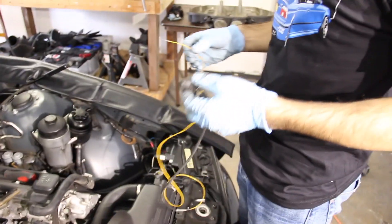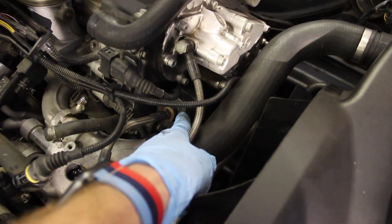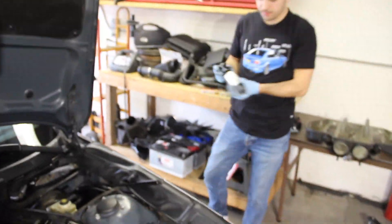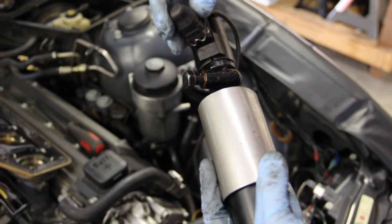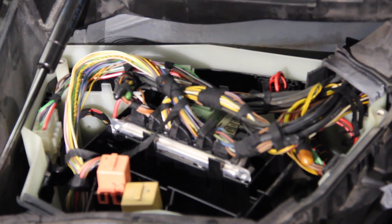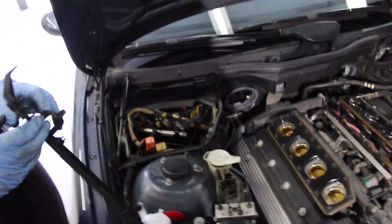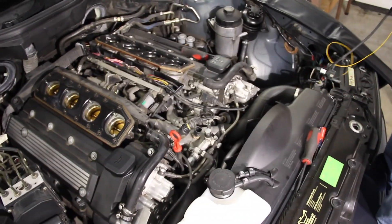That gets us in here, and now we have access to the actual cable run. We're going to be replacing the existing fitting with the new pressure accumulator unit that Hassan picked up. We're replacing that tube with this tube, running the electrical wire through the conduit and into the DME box. It's also important to note that your DME software needs to have been updated after about 2001 — it needed dealer service after 2001 — so the DME knows how to send the signal to hold pressure to the new pressure accumulator.